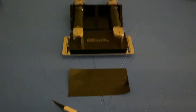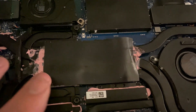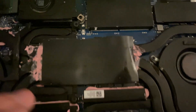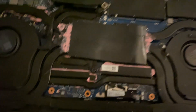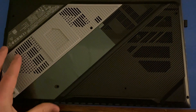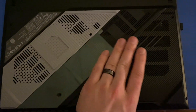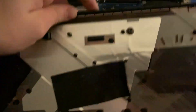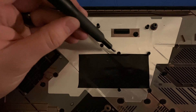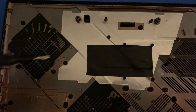Because there's no way to see through the bottom case cover without cutting it, and placement is pretty important to make sure it performs as well as it can, I went with the simple approach of using some tape, placing it on top of the heatsink, and then pressing down the case cover to see where it stuck to. I still double-checked by taking a few measurements with calipers from the top of the laptop to where the heatsink is to make sure it lined up about where it should. While doing that, I noticed there are actually four little tabs that come down from the bottom case cover above where the CPU mounting screws are, and realized I could use that as a guide for where it should actually be — and it lined up pretty close.